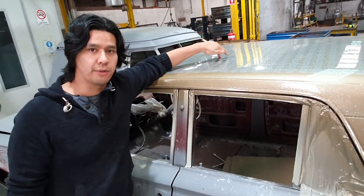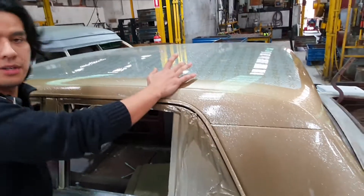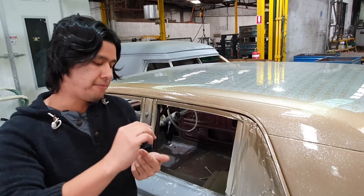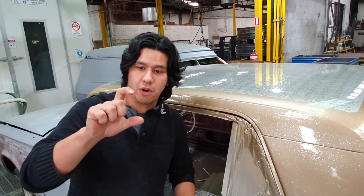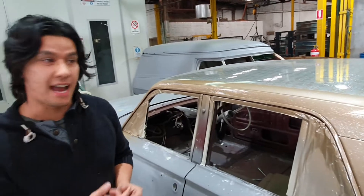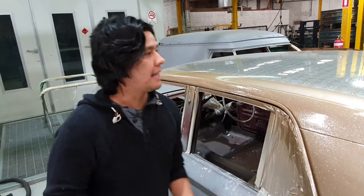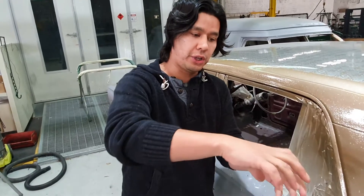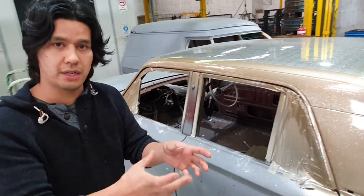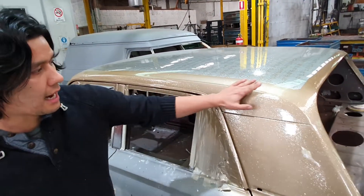The silver is — I'm going to say it's Ben's silver — again, paint I've just got lying around. I sprayed it probably a little bit too heavy because some of the pattern is a little bit blurry. After that I got three types of flake from Fiat. Each bottle was only 25cc — the tiny little bottles — and they were $14 each, so it wasn't very expensive. I mixed everything up and went to spray it but my gun jammed because the nozzle tip was too small — I think it was only a 1.4. So I grabbed a spare gun, quickly mixed up more clear, and poured in the flake — about 75cc worth. Then when I sprayed it with a 1.6 tip, I just went very carefully and this is what resulted.